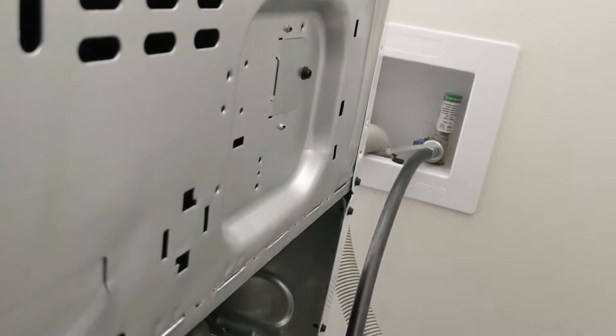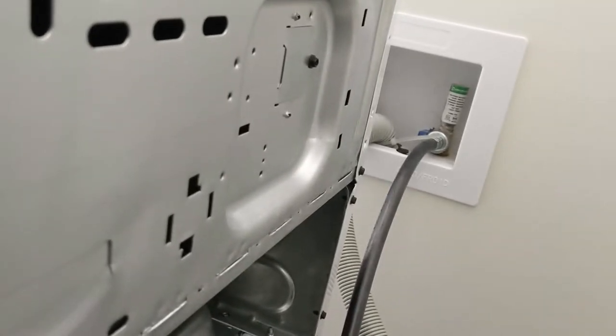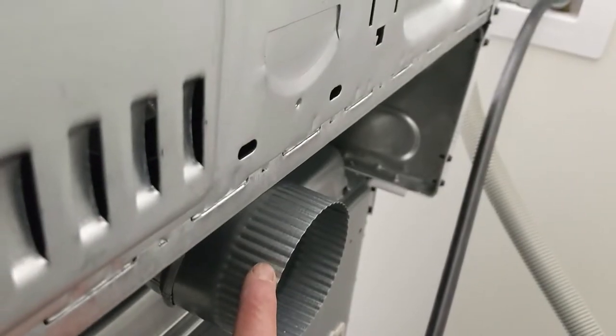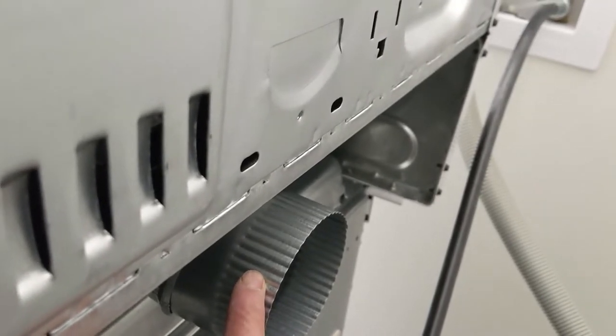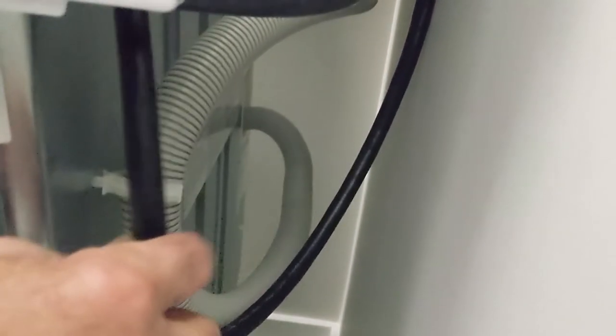The drain is in place. Just sometimes the drain comes with a little bit of water in it, so just be careful when you try to put it on the box. Then I'm gonna connect the vent — I'm just gonna use the flex pipe, the one appropriate for the dryer vent. Just gonna put two clips, one up one down, and the job is done, nice and easy, very simple.